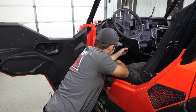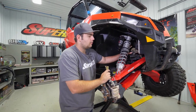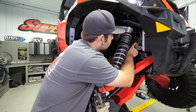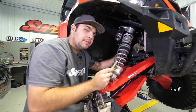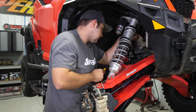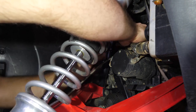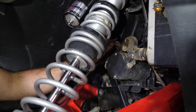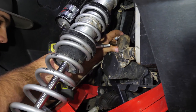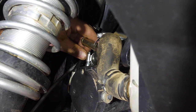Then we're going to get our machine off the ground and head up to the front to start cutting our radiator hoses. Grab our adapter fitting, go to our lower radiator hose, find a good spot, and cut right in the center of where we need to be. Looks like we can cut right here in the center — slide this side on, and if we need to trim any, trim on the opposite side to get the angle correct. There'll probably be some residual coolant left in the line. Now take our fitting and slide it into the hose on both sides. Make sure we haven't kinked the line — looks good. Grab our hose clamps and get them nice and tight.